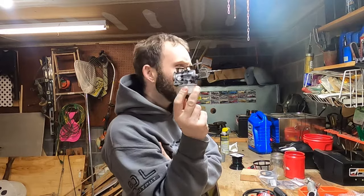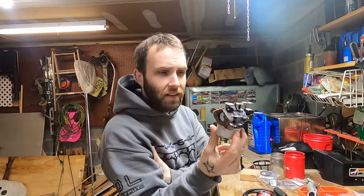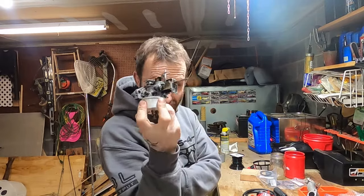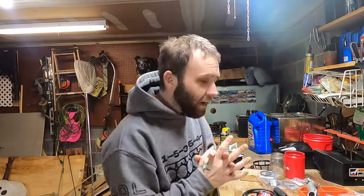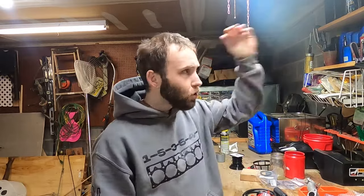What's the earliest I've ever seen? I have a 1964 outboard that has an almost identical carburetor to this. They've been using this style since like 1964. Gas was still leaded. To put something else into perspective, that 1964 outboard I have — the manual tells me I have to run 12 to 1, it's two-stroke. 12 to 1 is crazy. Everybody on the forums agreed from service techs down to your uncle that oil was just crap in the 60s. The reality is these run just fine.